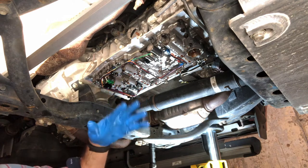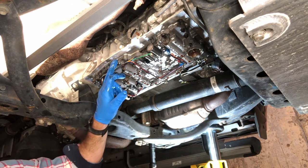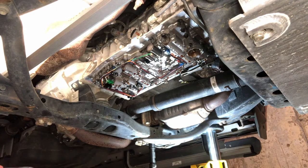As the valve body heats up and cools off and heats up and cools off, typically the gasket in there will end up wearing and shrinking or swelling, so it's a good idea to check the torque of valve body bolts on any transmission that you're pulling the pan on. It will just perform better and last longer. Just make sure that you've looked up the correct torque.